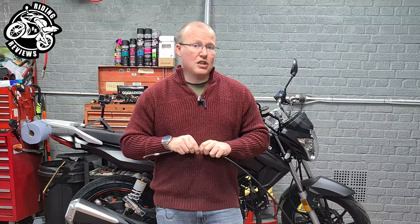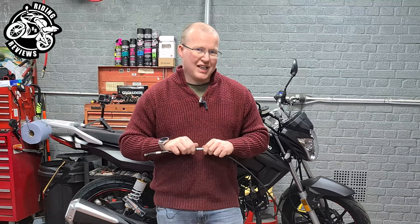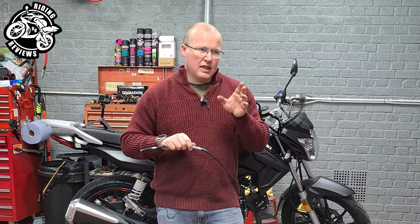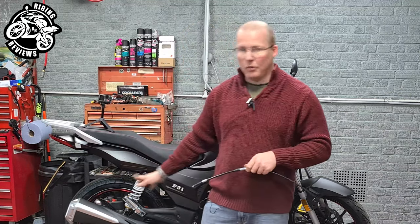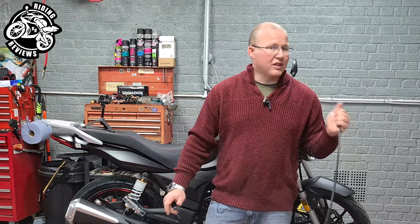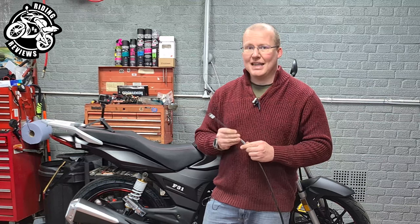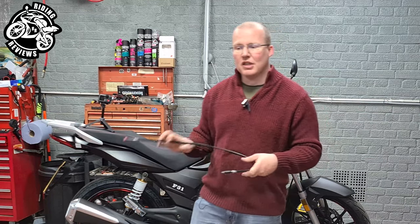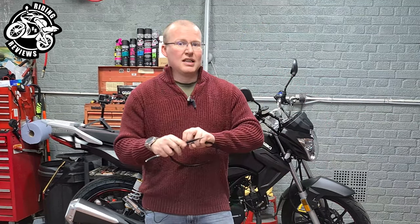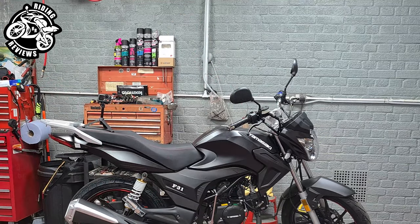This is something that you can do if your clutch is adjusted so that it's not stopping the back wheel. If the back wheel is stopped all the time, both of these adjustments aren't going to make any difference and you may need a new clutch. But if it's a fairly new bike then you may just have to do more adjustment on the bottom, and I will show you that now.